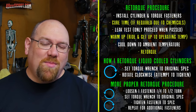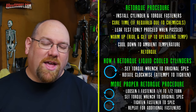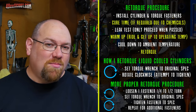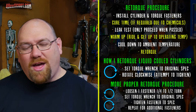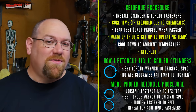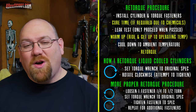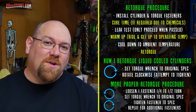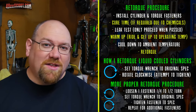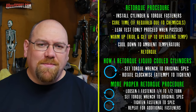I don't do this anymore because with my first liquid-cooled setup, it seemed like when I would break any of the nuts loose, it would be more likely that I may have a leak later. I'm assuming something must have started seeping through when I broke something free. So I just quit breaking them loose, and I just go over them quickly and make sure that the torque wrench clicks on each of the nuts in a crisscross pattern.